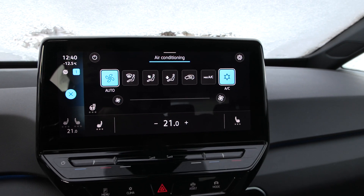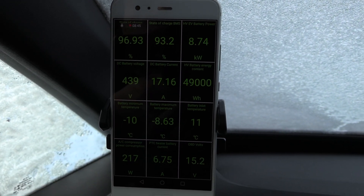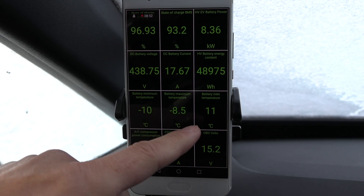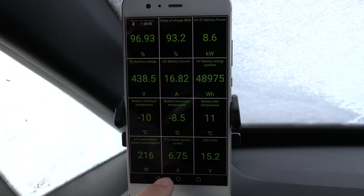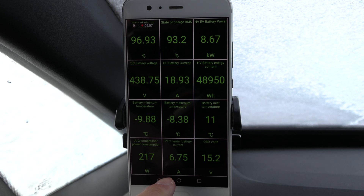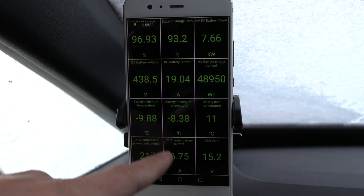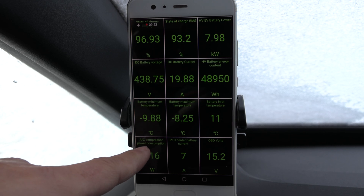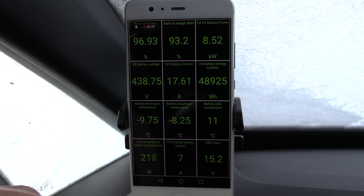The four kilowatt we saw here was not cabin heater power — it was the battery heater. The battery heater was running at four kilowatts, heating up the battery. It's heating up the battery inlet now. I'm not sure how the car heats the cabin. There's no way the heat pump is this silent — maybe they dampen the noise. So it's around three-something kilowatt on the battery heater. The car probably doesn't want the battery at minus 12 degrees — it wants it at around zero degrees.